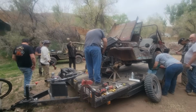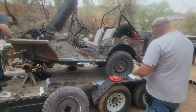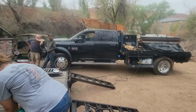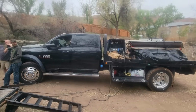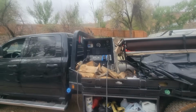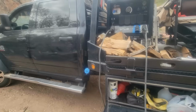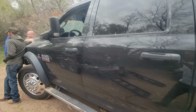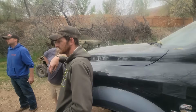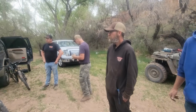They worked on my Jeep for a couple of hours, trying to grind it and weld it, and struggled a little bit with welding because the metal on that cross member tube was a little bit thin and they blew through it a little bit, but they figured it out and adjusted and got it welded on there really nice. We tried to pay them and they just shook that off. They're amazing guys.